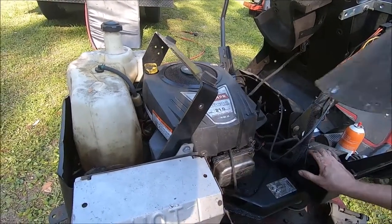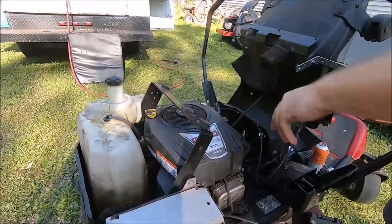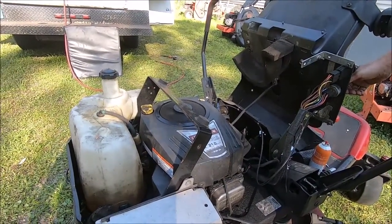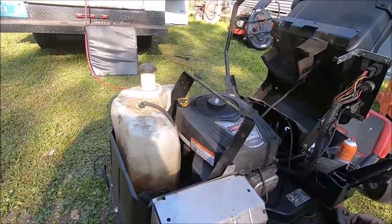So she hadn't been turned over in a good long while, so this is a pressure lubrication system, so hopefully that got oil circulated through it. We can just help it turn over easier, build up pressure and get that.